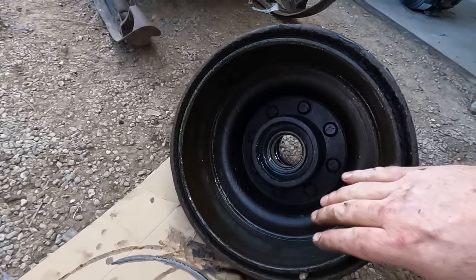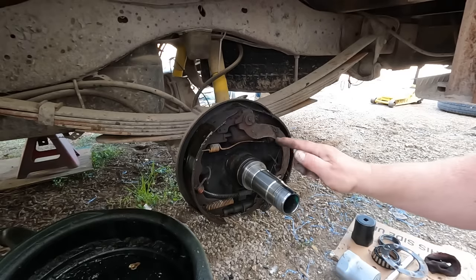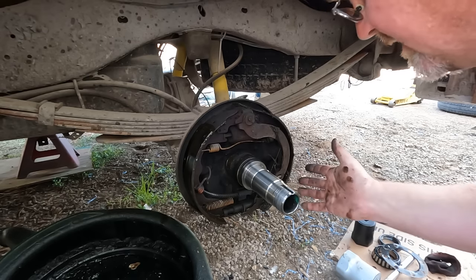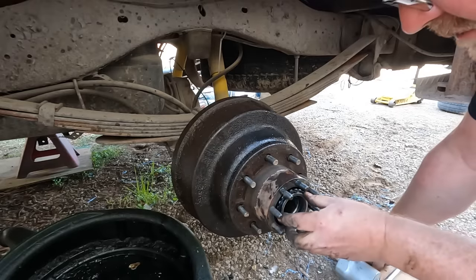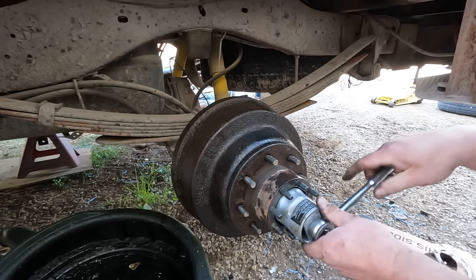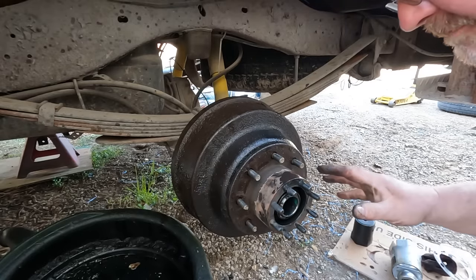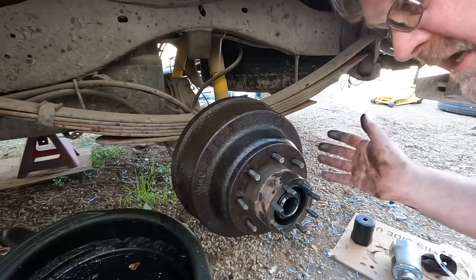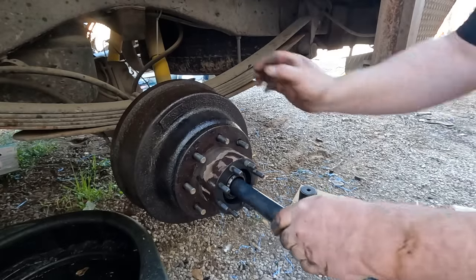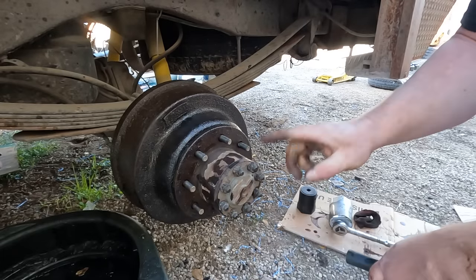The major issue is the level of gear oil that's pouring into the brakes - there is a wheel seal here, and that's probably bad. I could put in a new wheel seal, get new hardware, put new pads in, and get this all fixed up. But instead I'm just going to put it back together as is, because this axle has a 4.10 ratio. Around here the interstates have a 75 mph limit, and if you try to do that this motor is tapped out, hitting the governor at 2500 RPM. They're happier in the 2100 RPM range. Since I know I'm going to be driving for hours at a time on an interstate, I'd rather run a little lower. This axle won't do it, so I'm going to button this thing up and leave this as a problem for future me.